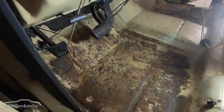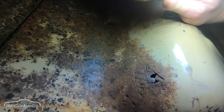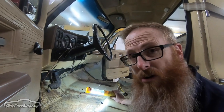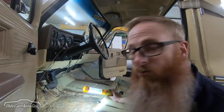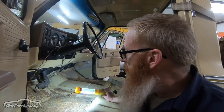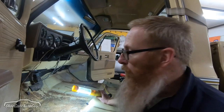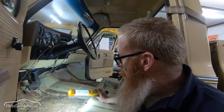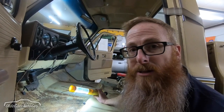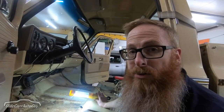Now that we've got all that cleaned up and scraped down, we found a few surprises. We found a hole right here which should be an easy fix, and also a couple of pinholes right here which we'll have to fix up. I still believe we really struck gold with this truck having to only deal with the cab corners and rocker panels. A few little patches here and there. What we're going to do right now is spray these floors down with the Rust Off, let that set so it dries up, and then tomorrow night we'll come back, finish getting this cleaned up, and lay down some primer and paint to stop it from rusting any further. Then we can tackle those two little pinholes and go from there.